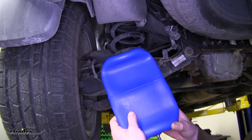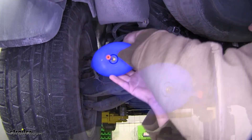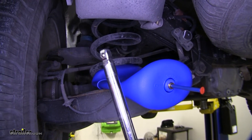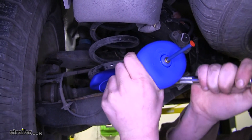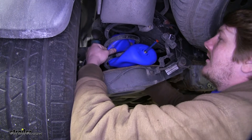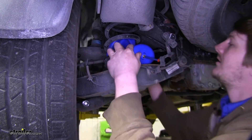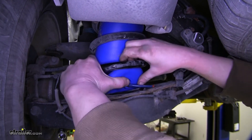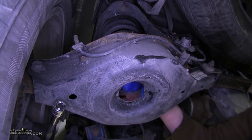We're back at our coil spring. Take the collapsed cylinder and at the lowest opening, push it inside the coil spring. If you're having difficulty getting it inside, you can use a blunt object with no sharp edges to help push it in — a half-inch extension works really well for this. Just continue to work it up in there. Sometimes it helps to twist it back and forth, making sure you're getting over any lips that are hanging you up. Push your air line hose down and around inside your coil spring and have it poke out the bottom.